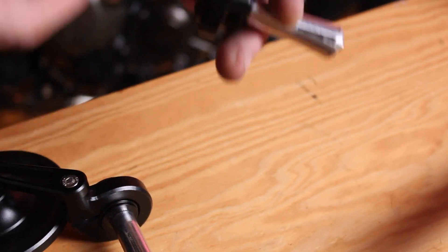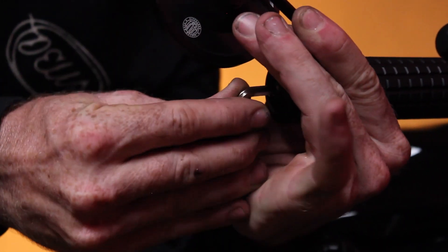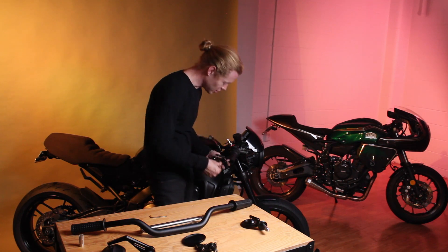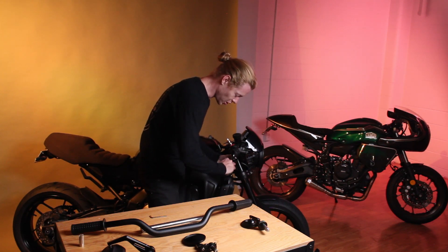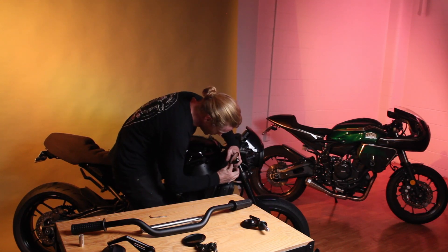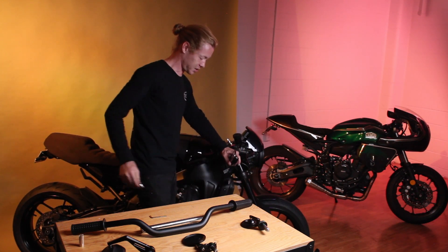Once you've got it splayed out off the bike to the point that it can just barely fit, that means it's already grabbing on the handlebar as you tighten up from there. This is the biggest single trick — tighten it off the bike so you can just slide it on and it's just barely fitting. From there you're only having to tighten it a small amount before that alloy sleeve grabs the bar and starts to conform to it as it splays out. That's now tight and hard mounted to the bar.